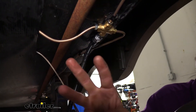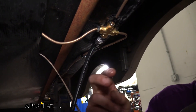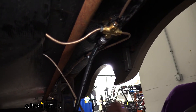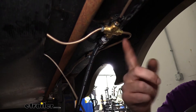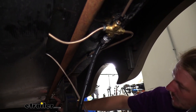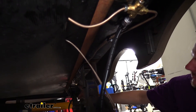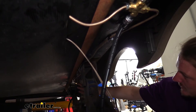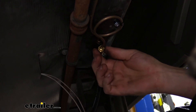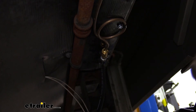You'll have three more lines in your kit. One is slightly longer than the other two — the two shortest are the ones that go from one axle back to the other. This is one of the shortest lines; it just comes out the side and we route it back following the propane line again. We did have to make a small loop to get rid of some of the excess, and then it just uses a single union to connect to a brake hose. When holding your unions, T's, or anything like that, you'll use a half inch wrench on the flat spots to hold them when tightening down.